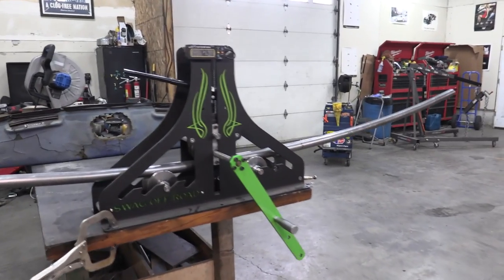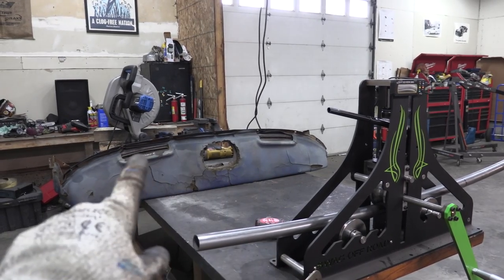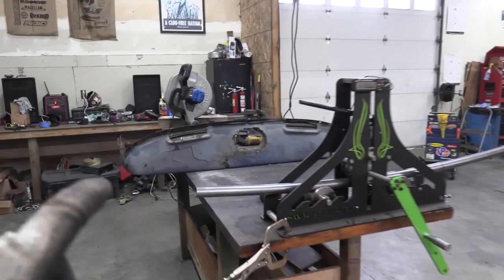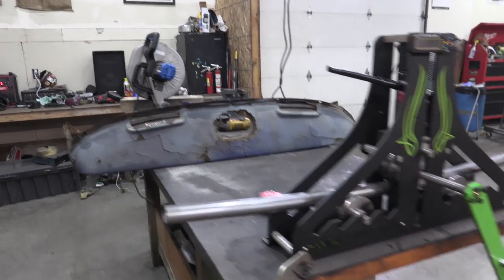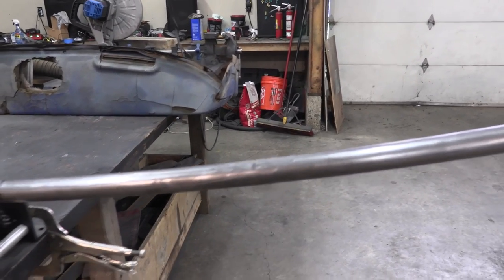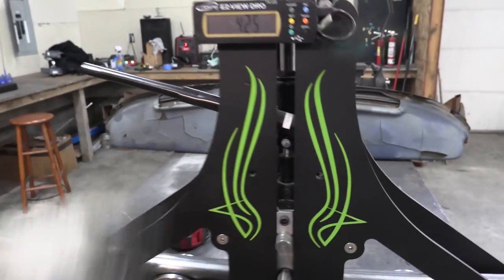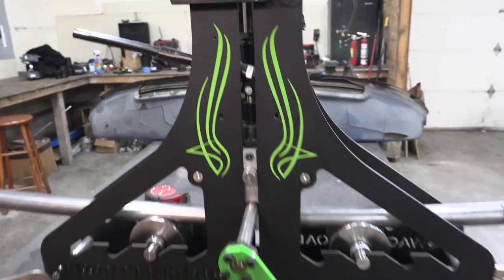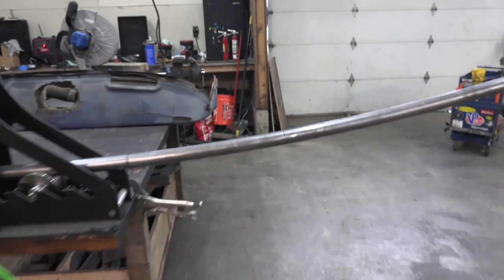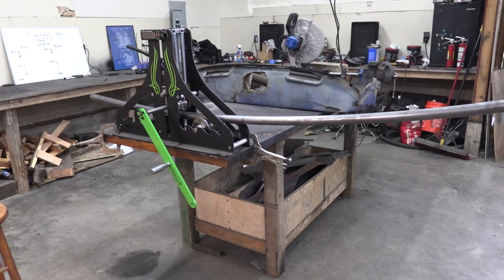This is going to be the trickiest bend of the entire thing, so I want to be very clear about what I'm doing here. If you look at the line on the front of this dash, the middle third has a certain bend, and then the outer thirds on each side get a lot faster - a lot steeper bend. The way I have this piece of tube bent right now is to match that inner third, and what I'm going to try to do next is match the two bends on the outer third. I marked a center mark where the center of the tube meets the center of the dash, and I've marked where I think the bend needs to get faster on each side. What's nice about this Swag Off Road roller is it has a digital readout showing exactly how far the jack inside the machine has been extended. If I match that number on the other side, it should be identical on both sides. I might have to use up a couple of sticks of tube to get it right, but these are the kinds of details I nerd out on.